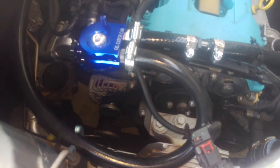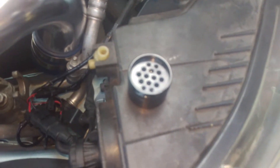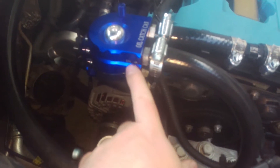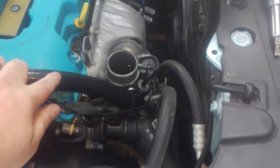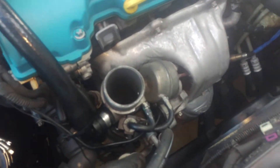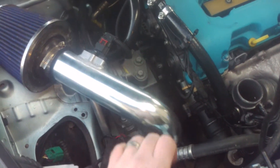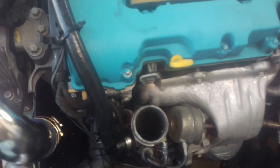On the intake side it has a baffle — I don't know if it's really that important, but it screws in here. On the inside it doesn't have that on the outside. There's that one-way valve — it flows into the turbo inlet where the air intake attaches. This is a cheap eBay one; I'm about to switch that out with a ZZP. This pipe diameter is the wrong size — two and a half inches, it should be 2.75.